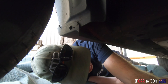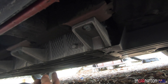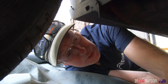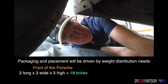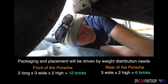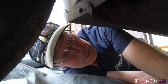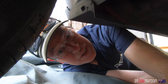The battery pack is just under here and it's a big flat pack arranged in a grid of bricks - kind of like oversized bricks, each of them 12 kilos, in a 6x3 packaging arrangement, nice and flat. We could maybe put them in arrangement 3x3 on top of one another - that'd correspond very nicely in shape to the 928 motor, so that might go in the front just like that. It makes cooling a lot easier. I'm very excited that we've managed to get effectively $20,000 worth of batteries in good shape. This car has only done 30,000 Ks and the batteries are at 90% state of charge currently, so there's no damage under here. That's a huge head start for our project.